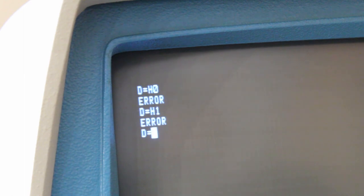Now, this is not the first time that I've had it working and then suddenly had it not working, giving us read errors. We tried both the removable platter and the fixed platter. Now, I think we have two separate problems going on here. The fixed platter has a thermal issue because, even before our current read error problem, we were getting read errors with it whenever I would try to dump it. It seems that you only get about 10 minutes of operation time out of the fixed platter before it just devolves into read errors only. Now, it's not a head crash, which is fantastic news. It just means that we have potentially a chip or something on the electronics side that is failing when it gets too hot.